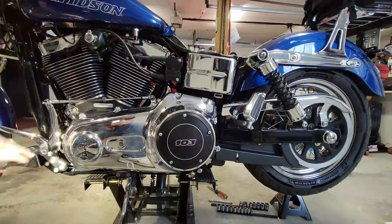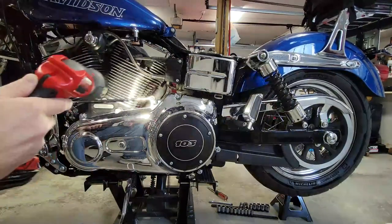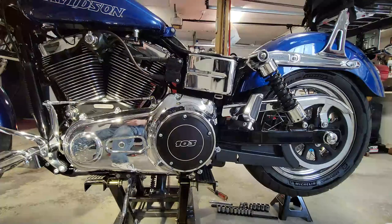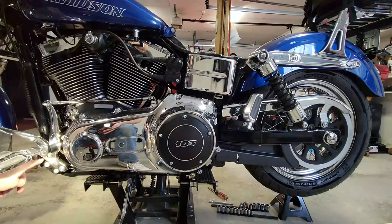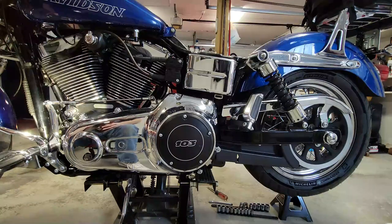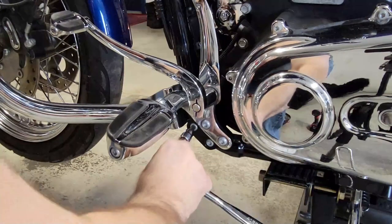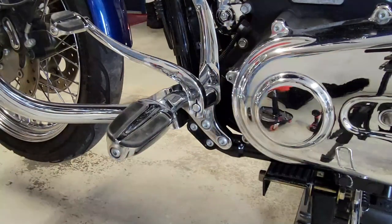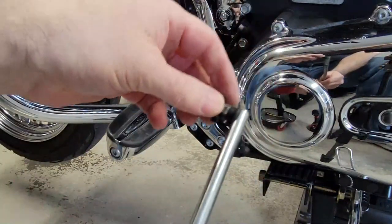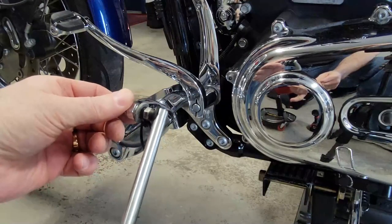A few other things while we're on this side. The foot pegs — obviously you want them to stay up — check that they're nice and tight, no squeaking or squealing. These foot pegs rotate, so check they're staying in position. There are a lot of bolts here for the forward controls — I have the forward controls reduced-reach kit. I'm going to use T45 Torx and check those. Also noting that the OEM-style shift rod is notorious for coming loose — I saw a rider on the road whose just popped out, requiring zip ties and duct tape to get him to his destination.